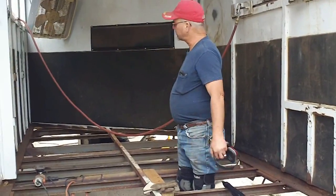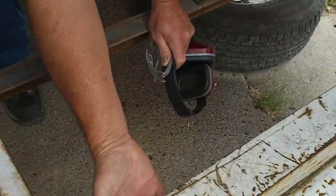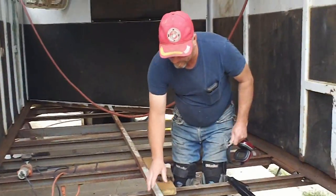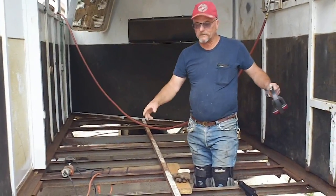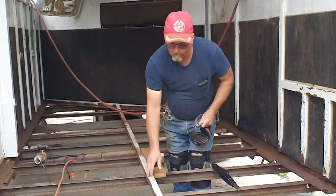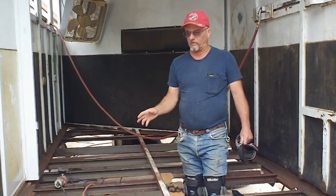Then this rear threshold, which is difficult because you can see that it's cupped and the wood sits in on a shelf, so it's difficult to get these things inside and get it clean. On this particular trailer — it's a Jackson — a lot of trailers back in the old days had this center trough. This is actually a wire carrier. Don't cut it — you're going to cut all your lights. Your wiring runs down the sides in this particular trailer. Miley did it, Circle J did it back in the day. This is for wiring. It goes to a junction box that goes up into your taillights, marker lights, those type of things. Know where your wiring is or you're going to create a heck of a lot more work for yourself.